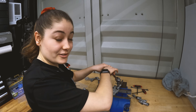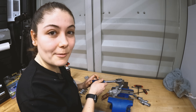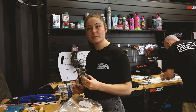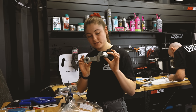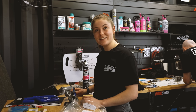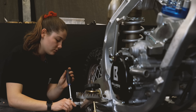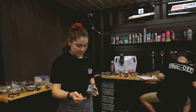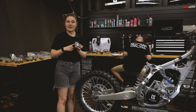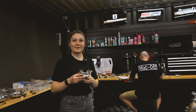This bolt hasn't been touched or removed in a while, so we just applied a little bit of heat to break it out of that OEM lock tight. We got the rear caliper all cleaned up — we got rid of the lugs and we got that factory look going. So let's get it put back together. We got the rear wheel back on, new axle blocks, the carrier and brake caliper all cleaned up. Carrier's obviously back on, we've got to get some pads in and get the caliper back on now.